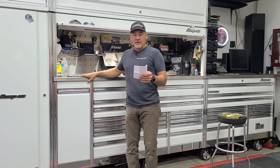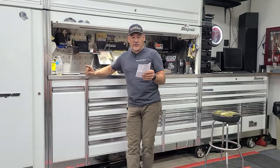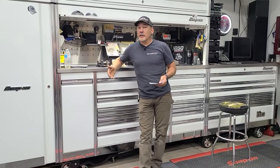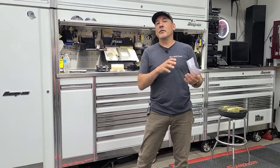So what are the things you should ask yourself? What's your use demand? What is your riding style? What's your track length and lug height? What's your target or expected top speed? Is belt heat a very real consideration in your riding style? The higher altitude you're at, the lower terminal speed you have, the lower horsepower you have — and engine horsepower is a very real consideration when gearing.